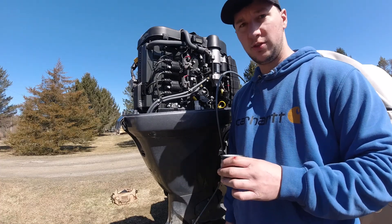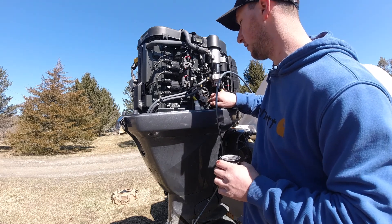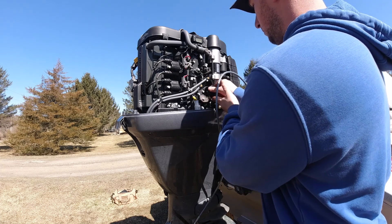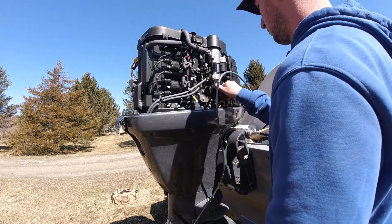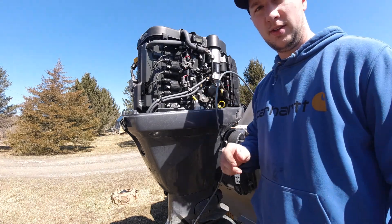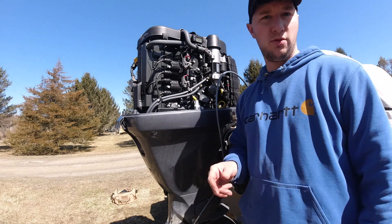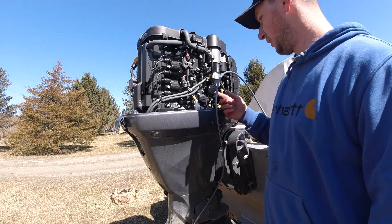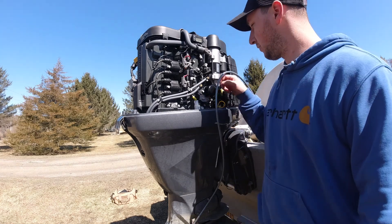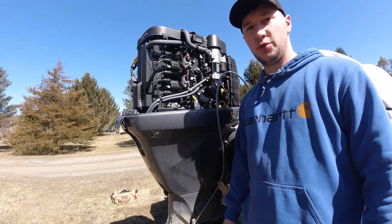Before you apply the filter, make sure that the sealing surface is clear and that the old gasket didn't stay on there. You do not want to over-tighten the filter — get it snug and then go about a quarter turn. I had the dealership change my oil one time and I could see where they put it on with an impact wrench, which was a joy getting off.